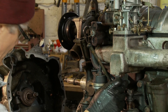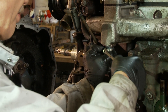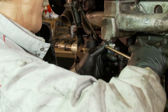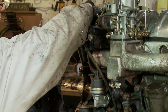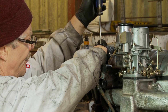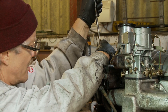Nice shaped pipe, and then all we've got to do is tighten up the clamps. These are aftermarket — these particular ones — there are various different manufacturers of hose clips. It's always a good idea to use quality ones when fitting hoses, because you really don't want them to break or fail in service. So it's false economy in my opinion to use cheap ones.